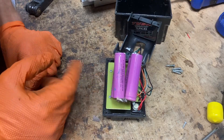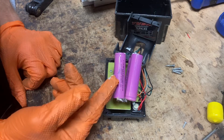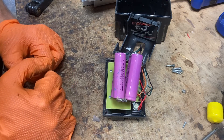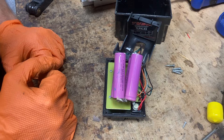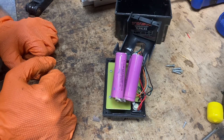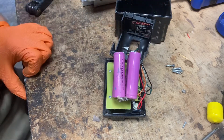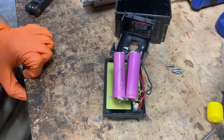In general, it doesn't make a lot of sense to use a lithium battery as a cranking battery or a battery that's going to be discharged in your motocross vehicle. You're not supposed to discharge lithium batteries very far before they go into dormant mode, and a lot of the ones I see coming back to us are in dormant mode — they're not even that old. The customer tells us they've stopped working, because it doesn't make sense to put something you're going to deeply discharge into one of these vehicles that's not meant to be deeply discharged. You're better off going with something lead acid, sealed lead acid, or AGM. Unless you're just trying to save every ounce possible, it doesn't make sense to go lithium — you're probably paying a lot more and they're not going to be as reliable. They're just not made for this sort of application.